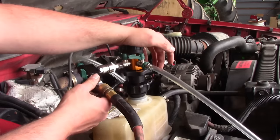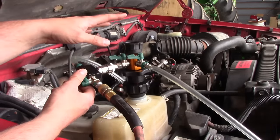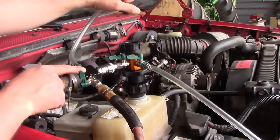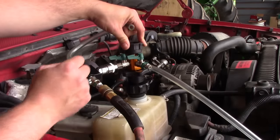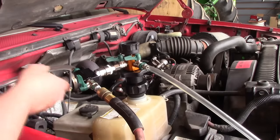We're ready to start pulling a vacuum. I'm going to open this valve and this valve — it's probably going to get pretty loud. Now this hose right here is the outlet for the air that goes through the Venturi. If you still have coolant in your cooling system, there's a chance it's going to get sucked up and blown out of this hose, so you want to point that towards the new guy before you turn on the valve.